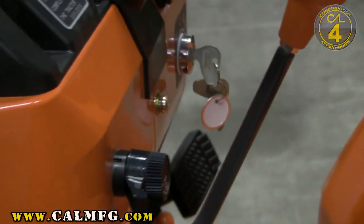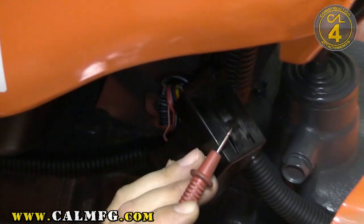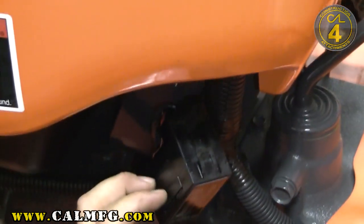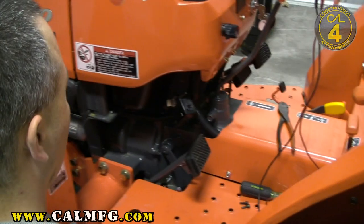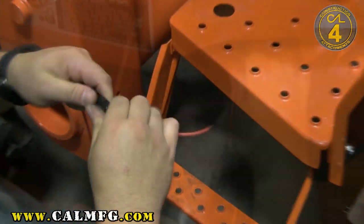Let's go ahead and see if that's different with the switch on. I'm still on the same wire, on the tractor ground, and I've got 12 volts — 12.6 volts DC — so this is ideal. We'll use this red wire with the white stripe. I'm going to shut the power back off. We're going to use a side-by-side splice connector to make this connection. We check all these kits before they go out and verify that they have a 20 amp fuse.